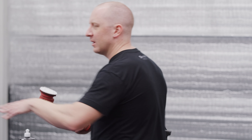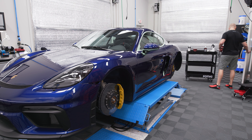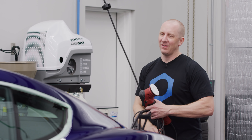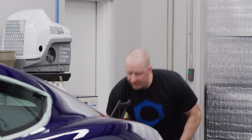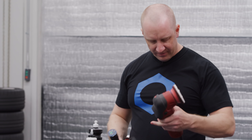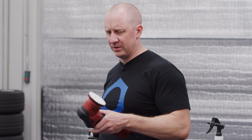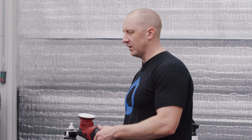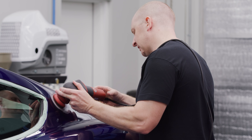I want to do the three-inch up here first. I found myself using the XFE7 — I like it a lot more than the Rupes three-inch version. It feels smoother, feels like it has a little more torque, and I like where the speed dial is — above the power cord, not below it. I don't even know what it costs, I think it's a little less expensive. Using the cordless version on the car has done extremely well, even needing to hammer down quite a bit on some areas. I'm running at speed four and a half.